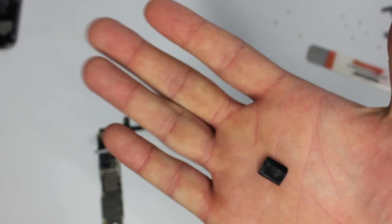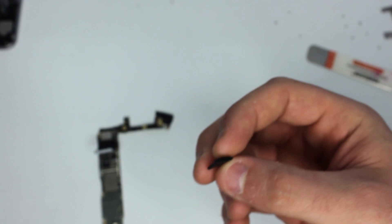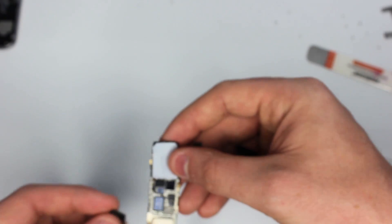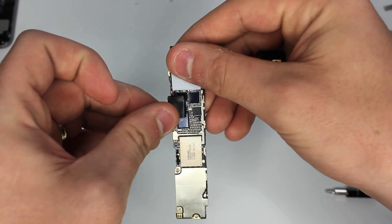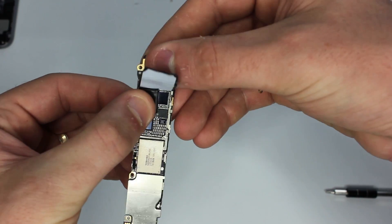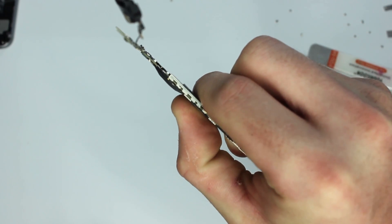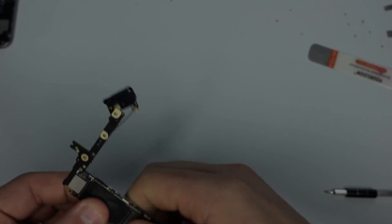It's pretty thick but not super bulging. A common issue people were having was the fix coming right back, and that's because it wasn't thick enough. Take this tape and put it right there — as you can see it covers the top two chips. Now put the soft cover back down; you can see there's a slight bulge but it's ever so slight.